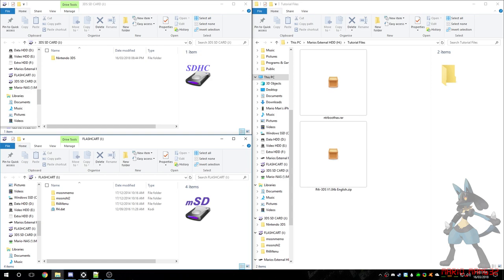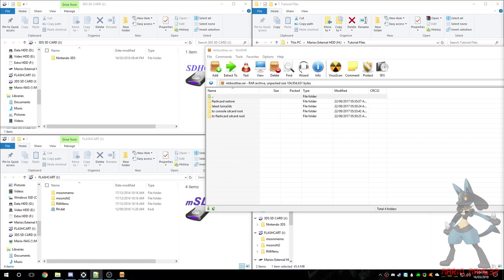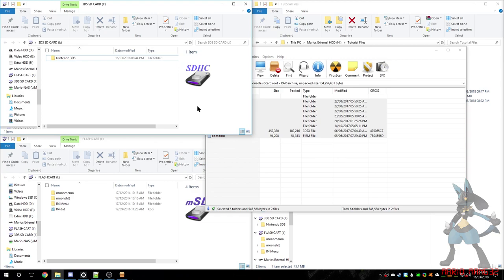Now, in the description, you'll have to download the NTRBOOT.RAR file, or the NTRBOOT package file, in the link in the video description. To open this, you'll need either WinRAR or 7-zip. I'm using WinRAR. So all you have to do is open it, go to console SD card root, and everything here goes to the console SD card, the 3DS SD card.